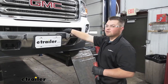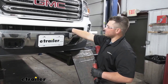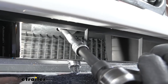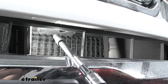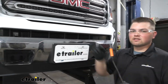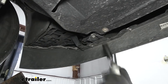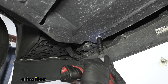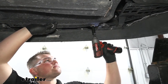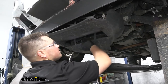We now have a couple of 10 millimeter fasteners we need to remove. Coming up to this grill portion, there's a 10 millimeter fastener located in a plastic flange that's kind of angled. If you're having trouble getting that bolt out, I suggest grabbing a magnet, sliding it through that opening and grabbing your bolt. We'll repeat that same process on the passenger side. We now have four 15 millimeter bolts to remove off of our splash guard — two on the front and two on the back — hold the splash guard with your other hand so it doesn't fall on you, then lower it down out of the way.